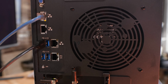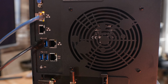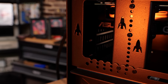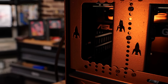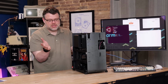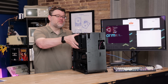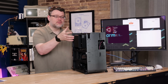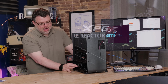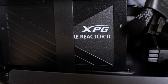In the build, there's also a lot of fun little details, like there's some meaning in the arrangement of the planets on the back of the case. You can see there's little rocket ships stamped out of the metal here and there. A lot of fun, cool details. This bracket for holding the GPU is very sturdy, so these things are very ship-worthy, or if you travel to trade shows, things like that with these machines. These features help prevent the machine from breaking itself. Also, physical mechanical support for the heatsink, so you've seen some of those get bent in shipping sometimes. It's well supported here. Even the power supply has an extra bracket to hold it down sort of at the mid plane, which is very nice.